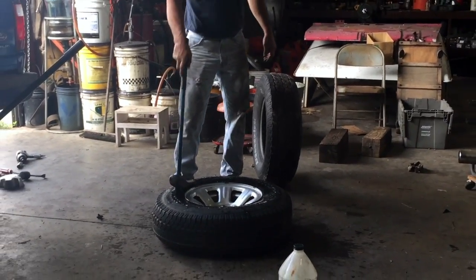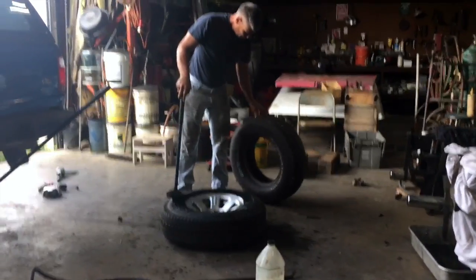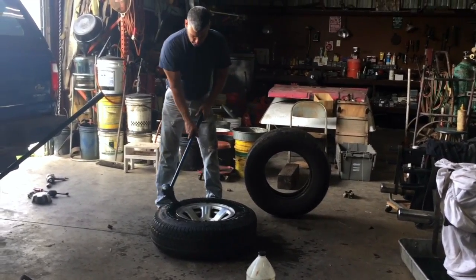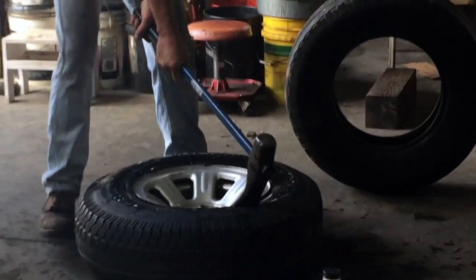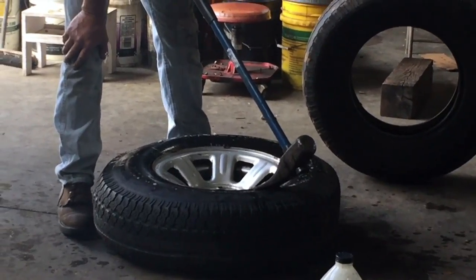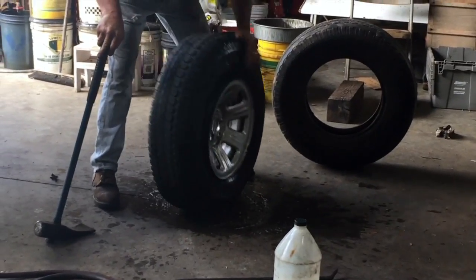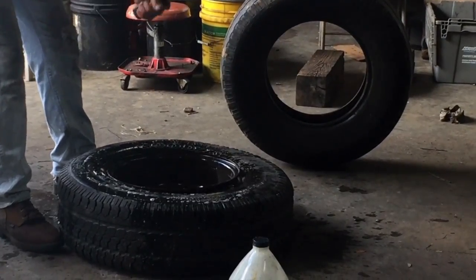This is a little truck we just put together with a diesel engine and I just had a tire separate, so I'm just swapping it out with a piece of junk. This tire came off a tractor - it's the same size so we're just using it temporarily for some shakedown runs on this truck. You have to be really careful here not to ding your rim - always start farther away on the tire than on the rim. I would not suggest doing this on aluminum rims because you can chip or break the rim. Steel rims are much more forgiving - you can hammer them back into shape if you mess up. That only took one hit; sometimes it'll take several. The longer you let the soap soak in, the better.